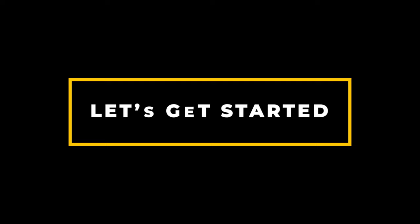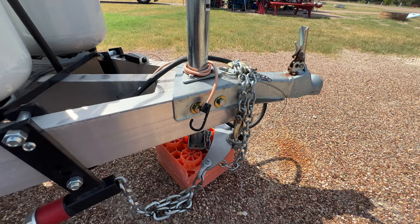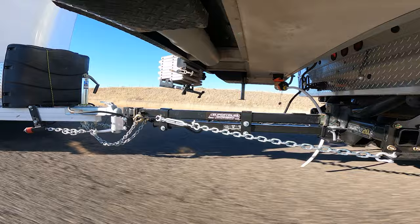I'm going to have to remove this propane tank cover. The Anderson setup bolts right here and I can probably just leave it in place, but I'm not going to be using this hitch anymore — I'm switching over to a standard hitch because I don't have the towing extension anymore. I'll leave a link to that video down below. I used to tow this trailer with a 48 inch extension and needed the weight distribution hitch for that.